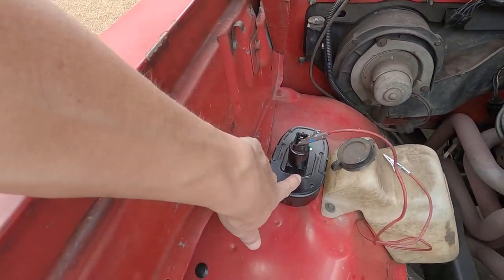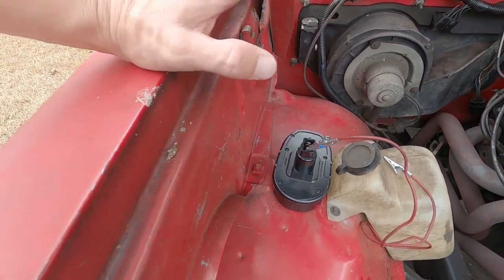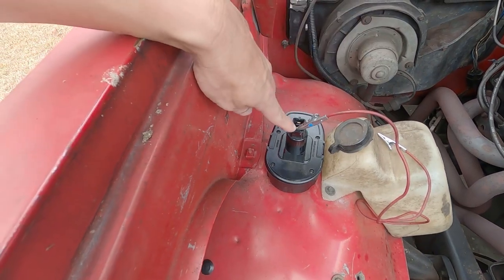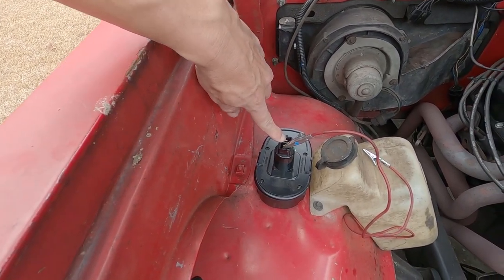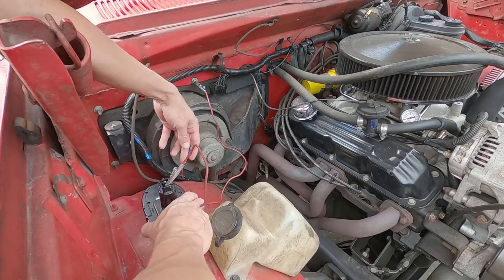So as you can see, with 12 volts that pump will not pick up fuel. If it's already primed it's fine, but to get it primed I have an 18 volt battery. We're going to talk about safety in a minute — and will it harm the pump — but just go with me for a minute. I have an 18 volt battery, a jump wire to the negative side, and I'm going to ground it to the chassis and use the positive to feed my fuel pump.